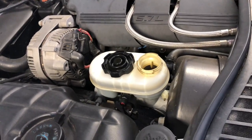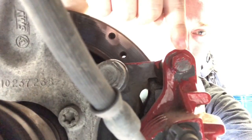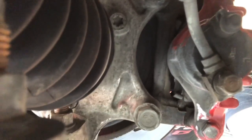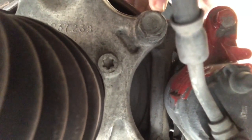Here is the back side of the brake caliper — same as the front. This is the bolt that hinges the caliper down so you can check the brake pads, and then you have the two bolts for the caliper brackets. This bolt is 15 millimeter and these two bracket bolts are 21 millimeter.